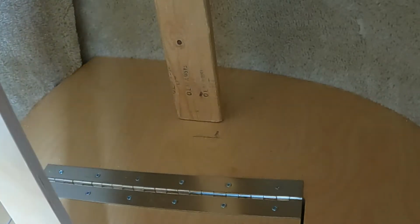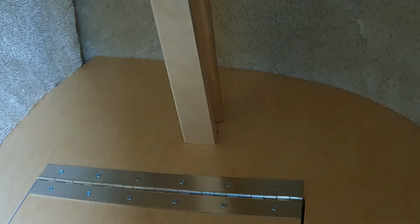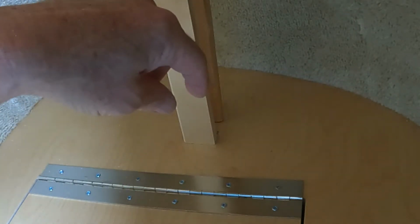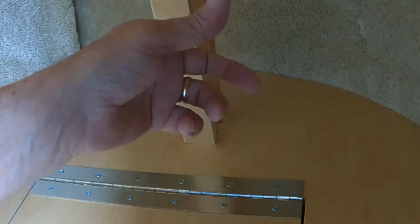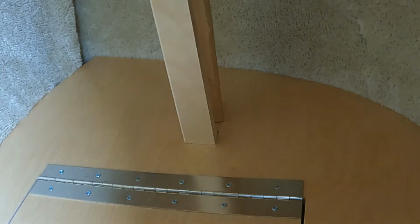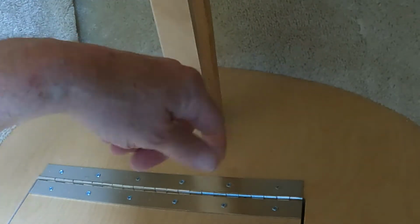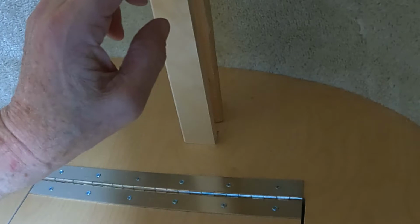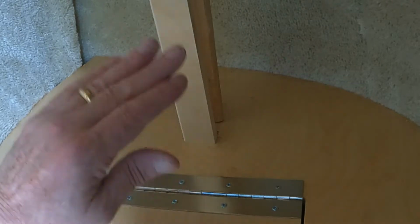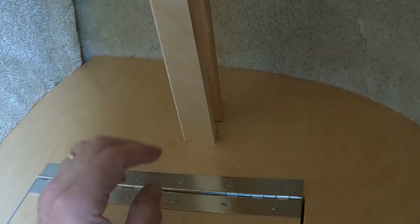And then after you get your light kit on here, you install it with your screws to support the strip just like usual. But before you do that, you put the plug down in the hole. You can actually plug the light kit in if you want. You can turn it on if you want. But yeah, you thread the wire down before you attach it. And then get it in place, and then install all your screws on your support strip. And then your light kit will be installed.